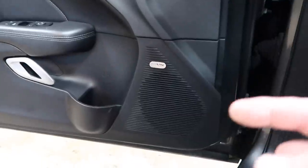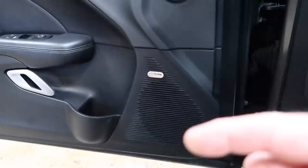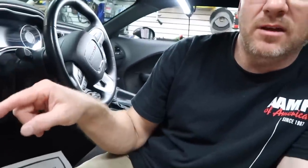Now because it is an RT with the Alpine system, an Amp Pro would be ideal, but that would cost more than probably the whole stereo we're putting in. What we want to do is tap into the driver's front mid-bass speaker, because that is actually the subwoofer signal. The rear deck speakers do play a certain amount of bass, but it's nothing compared to the bass that comes out of the door. When you're doing the Alpine system, if it doesn't have the subwoofer in the rear deck, make sure you tap the door speakers. The amplifier is going to get mounted in the trunk.